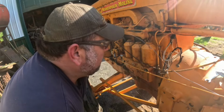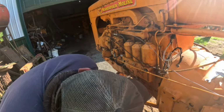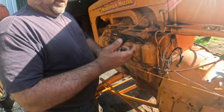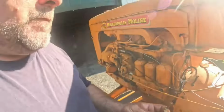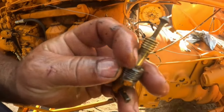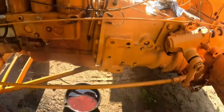well, if it's leaking air, it'll leak fuel, I'm sure. But at the minute, it's not leaking any fuel. Wouldn't that be something? I don't know if you can see on there, but see how that packing that was on there to seal on that shaft is pretty much non-existent. There's very little right there.